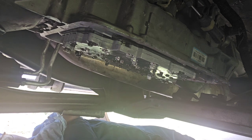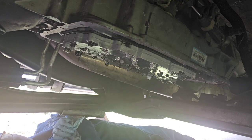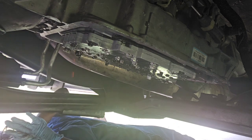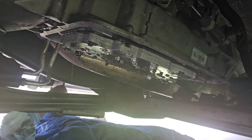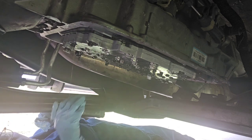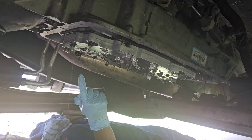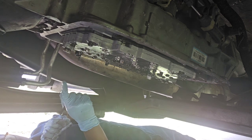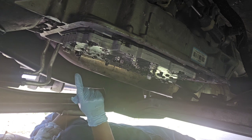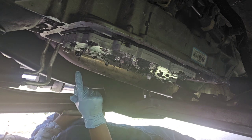And over time, I think that's why my first transmission failed, even though I still got good mileage out of it. One day it just went boof. And I didn't service it but one time either. But still, I think it was due to that spin-on filter falling down, because the plastic piece made to spin it on, over time, with all of the heat and temperature changes, could crack, and then that whole spin-on filter drops off and destroys the whole transmission. So what I did, you can unscrew that plastic bolt, and there's a $20 screw of the same type made out of aluminum. It's on Amazon for the 68RFE transmission, and you can replace it, and so now you won't have to worry about that issue ever coming up again.